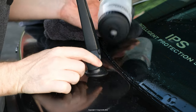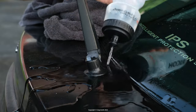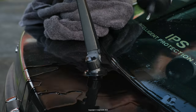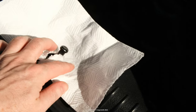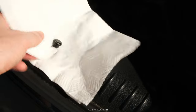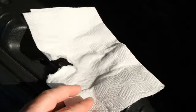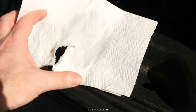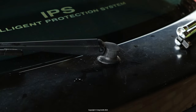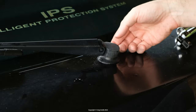So, process of elimination. I was at this grommet, which seals the hole where the rear windscreen wiper motor pokes out through the hatch. So I gave that a good dousing. And a few minutes later, sure enough, I was seeing a wet tissue. So at least it's not a windscreen seal, but that leak is not just annoying in the water that gets in the spare wheel well, it's presumably also getting the wiper motor and maybe nearby wiring wet, because obviously the motor is directly below that hole, so it definitely wants to be fixed.